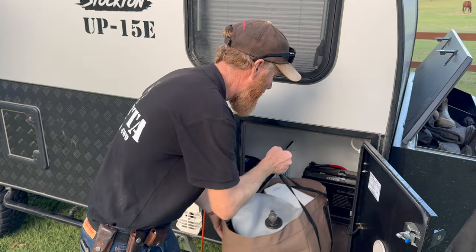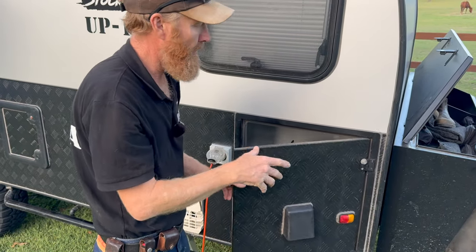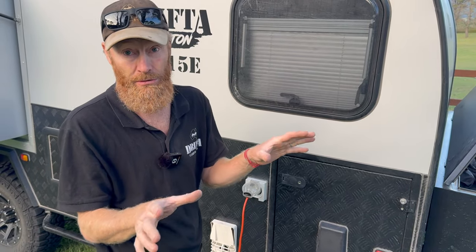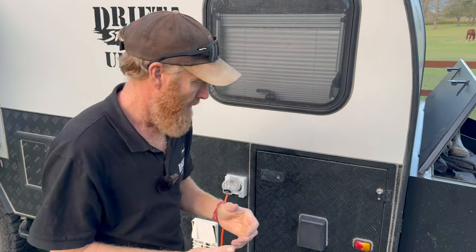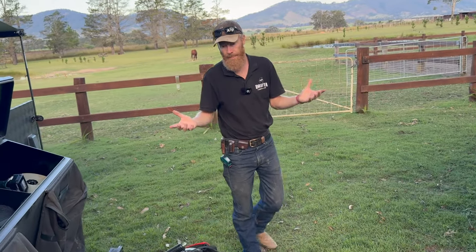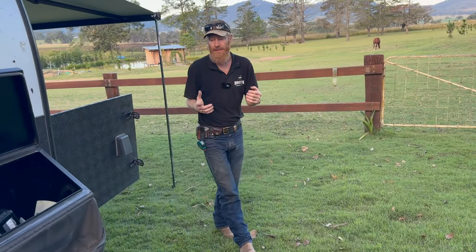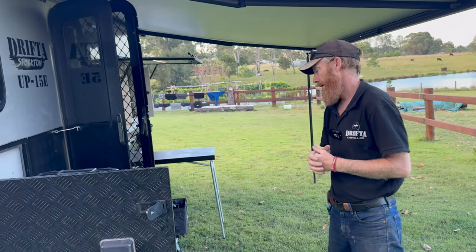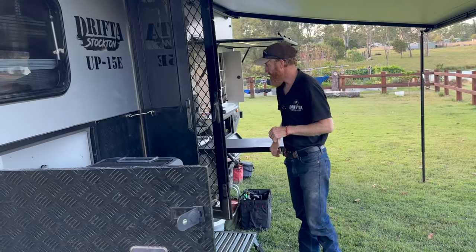And you might find that if you've got the fridge on and all the lights on, you might be using 12 amps. They're always amps per hour. So that's a 135 amp hour battery. That means that I could use 13 amps for 10 hours, okay? So if I were doing that at night time, there's like 5 hours maybe. So it's surprising how much it adds up. But it's good. It's a good way of doing it.